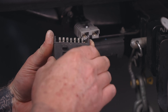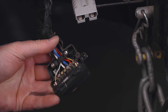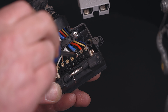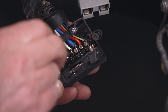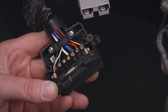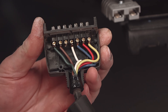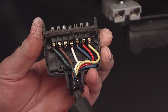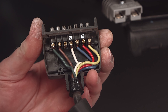To diagnose these faults, first remove the covers from both the trailer plug and trailer base. If necessary, detach the trailer base from its vehicle mount. Carefully inspect all the wiring. Confirm that the wires are securely fastened beneath the connection screws and no loose wires are present by gently tightening the connections. If you are experiencing one red flash, pay particular attention to pin 5 the blue wire and pin 3 the earth wire. If you are experiencing two red flashes, you will need to pay attention to pin 6 the red wire and pin 3 the earth wire.